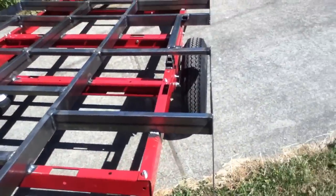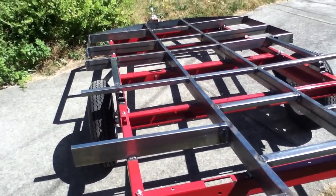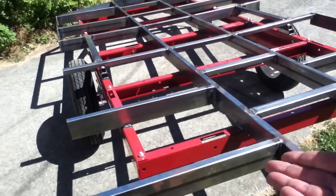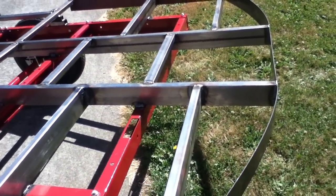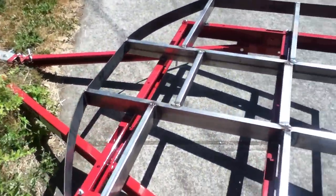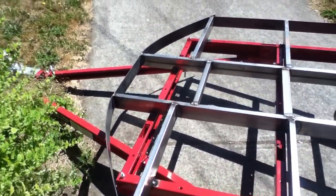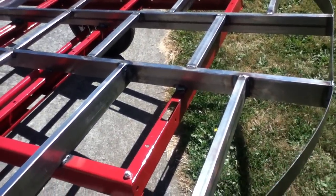I decided to go with rounding the front and rear. These pieces were cut at 10 feet, confirming it's a 10-foot-long trailer. I was also thinking about lightweight portable building sections that are 10 feet long — I need to be able to jack the corners off of them using a high-lift jack with an extension, and I didn't want special fittings on a little portable building. So I need the corners of the trailer to overhang, and I wanted a bumper shape anyway to do away with sharp edges. I need an open corner so a building section sized to the trailer has something to get a jack under.